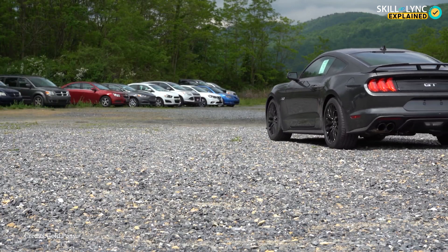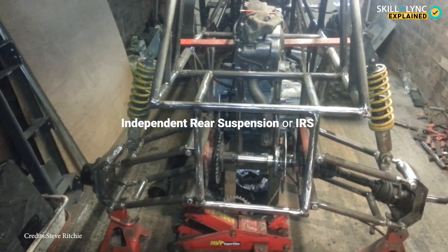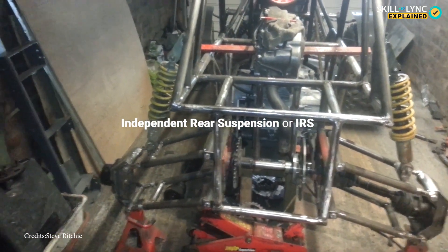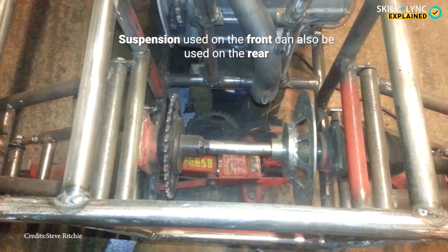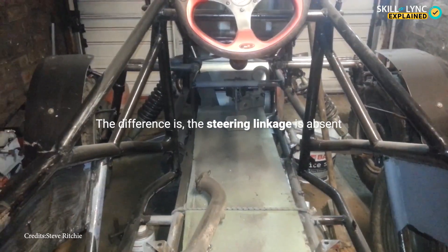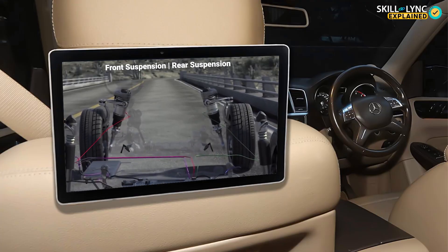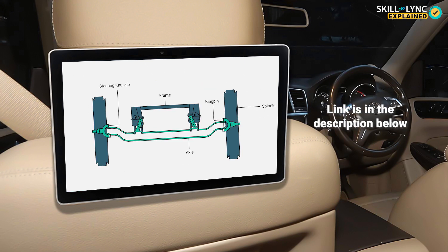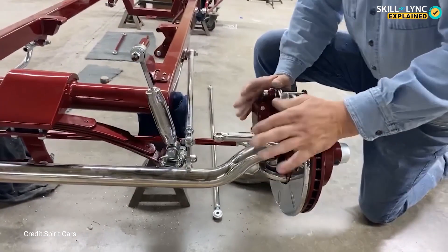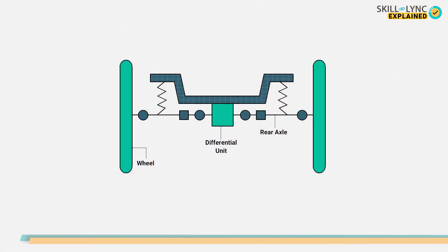If you're thinking why from nowhere we're talking about the car, I'll tell you why. The rear suspension used in this car is an independent rear suspension, also called IRS, which is going to be the topic for today's video. Any suspension that can be used on the front can also be used on the rear, but the difference is that the steering linkage is absent on the independent rear suspension. In one of our previous videos we've spoken about independent front suspension — the link for that is in the description below. As explained in the previous video, the working and the features of the independent rear suspension will be the same. This image represents a simple diagram of an independent rear suspension.